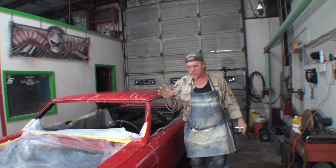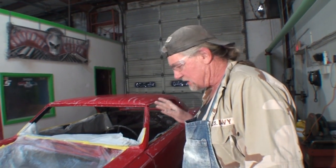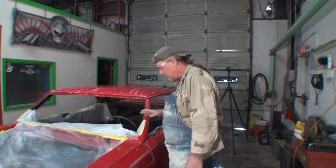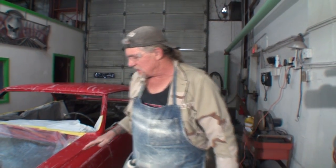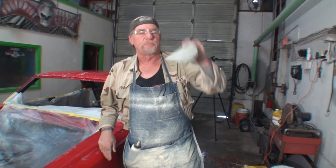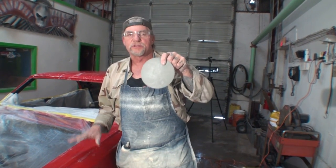Okay, I was telling everybody about color sanding the car for buffing, and that we did the 1000, which took almost a day and a half. You remember that, right? Yeah. You did a lot of it yourself. Yes. Then I told them about the 3000. Actually it's 1500, not 1000. After the 1500, we're using 3000. I showed them that, and told them about that glass finish they're going to get. This is a polishing pad, but it's also sanding it to a 3000 grit.